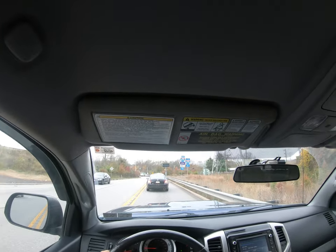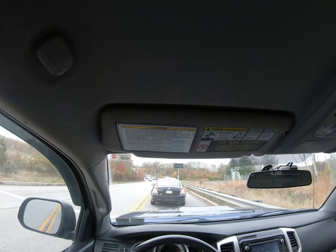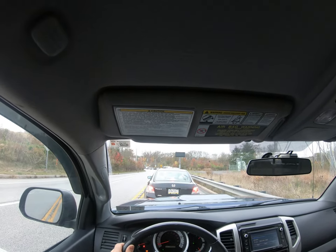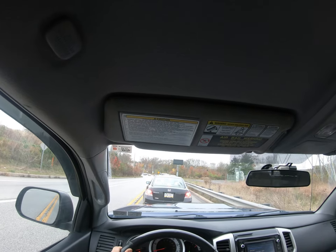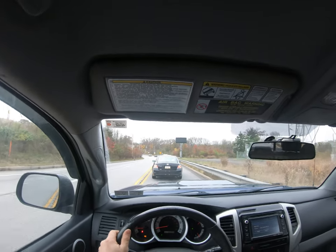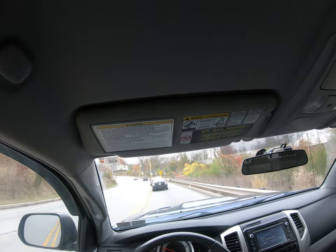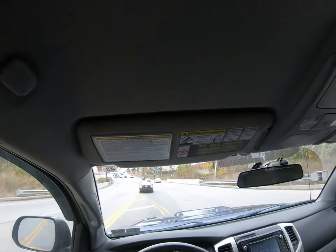I also had another issue: every time I'd hit a bump at slow speeds, usually on the rebound side of the shock, I'd get a loud clank. Long story short, it turned out that was the lower strut bushing in the front — or shock bushing, whatever you want to call it. The stock Bilsteins that come on these, the yellow and blue — I think they're the 4700s. The bushing was collapsed, and it was basically metal on metal every time it would hit, at the right jounce and rebound.